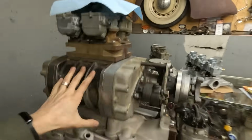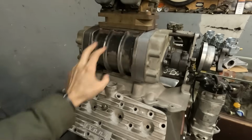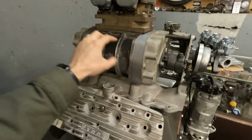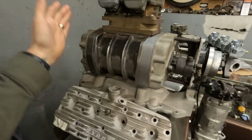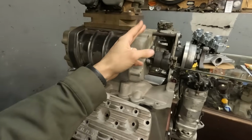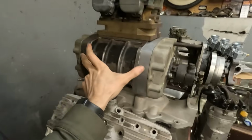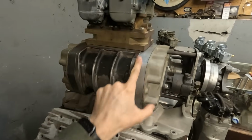So now the way I have it, it took me a bunch of tries to get this configuration correct, because this is a 371, but I used a different 371 to take the internals from, and the end plates were different. The covers were different too, and I was trying to use the middle plates here that have the bearings on them from the other blower, because I knew that blower turned really nicely. Everything was rebuilt, it was perfect.